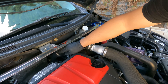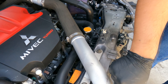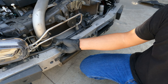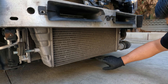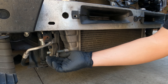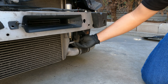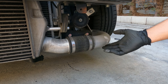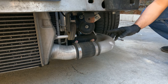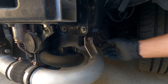To start this off, we're going to start by unclamping this clamp right here and then pull off this pipe. This should lead all the way down to the intercooler itself. And I'm going to undo this portion. For the intercooler, there are two bolts on the bottom — one right here and one right here. And then after that you're going to have to undo these hangers. It's rubber so you just pull it off — one right there, one on this side. This is the lower intercooler piping section. There's a bolt right here and this leads up to the engine.